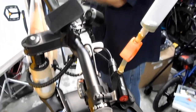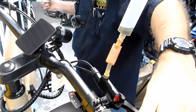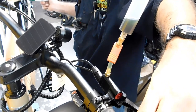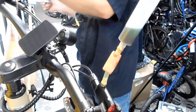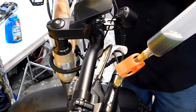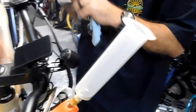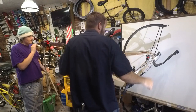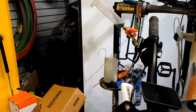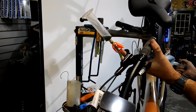As you see, when I turn here, see how much air is now coming out? I'm going to pull this in and we should see a little bit more air — there was a little bit. Pull the brake lever in, more air in. Just keep working it. I'm going to rotate the handlebar some more. We're starting to get a bit too much fluid in here — I don't want it to spill. I'm going to pour some of this out, and that is some dirty-looking fluid even though this bike is brand new. We're going to push some more fluid through and move this around. Look at that — we got a lot more air there. I'm going to pull that in, out, in, out.